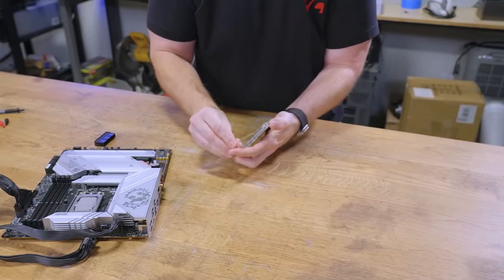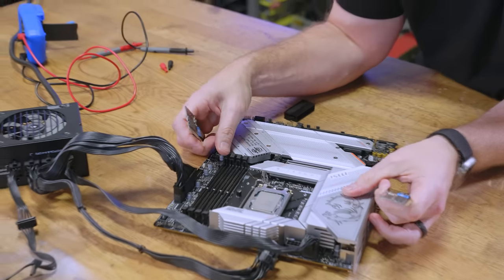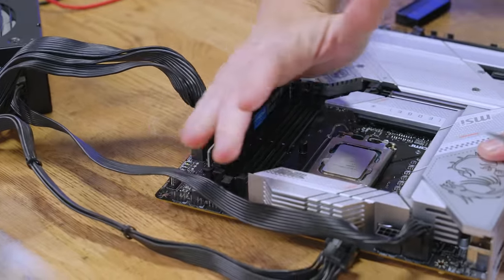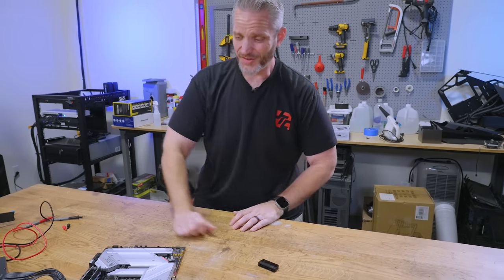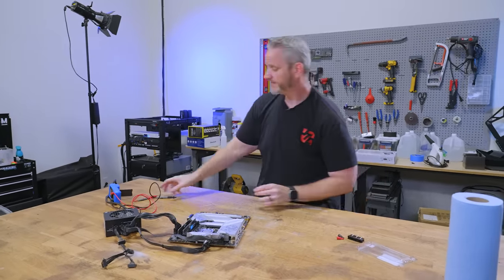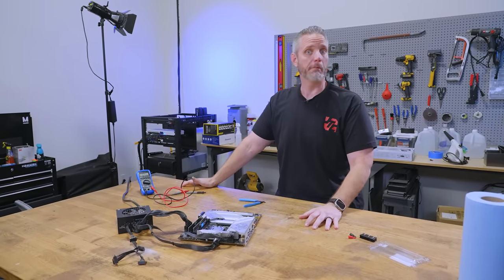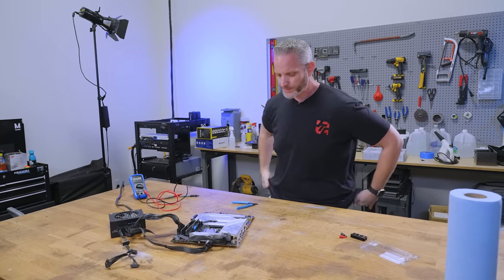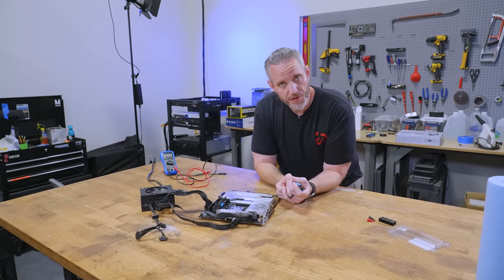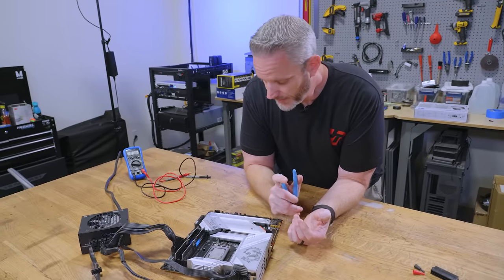I'll put RAM in there. This is the most basic RAM I've ever seen — regular old Crucial DDR5 with no heat spreaders or anything. They did not sponsor this, I just grabbed it. Honestly, I'm hoping it doesn't just turn on right now, because if it does, then this whole video is just dumb. I said it in the video where it broke — I've had this happen before where you leave it sitting on a shelf and go back to it later and suddenly it works. I have a 12600K sitting in here and a Z690. They're backwards compatible, so the older CPU will work in a newer motherboard. So here we go.